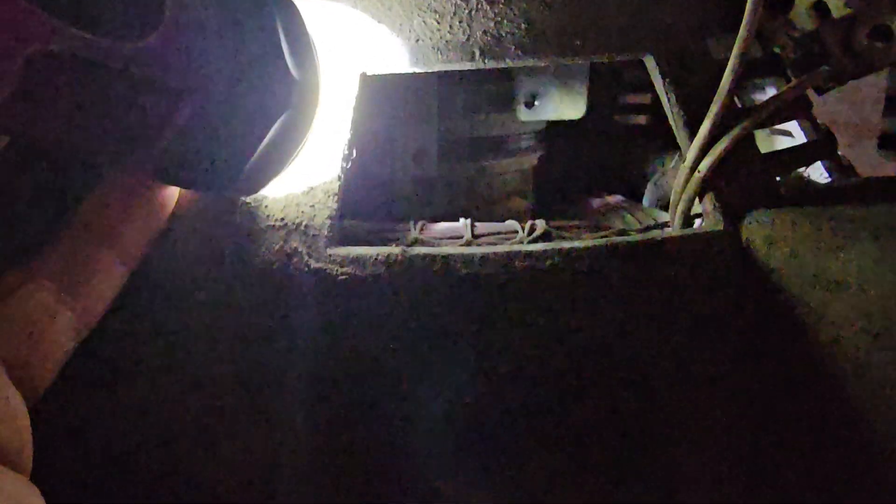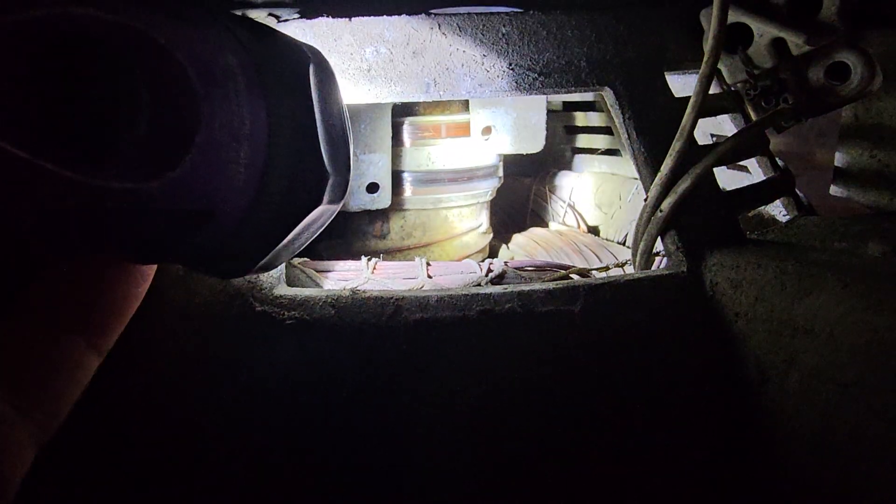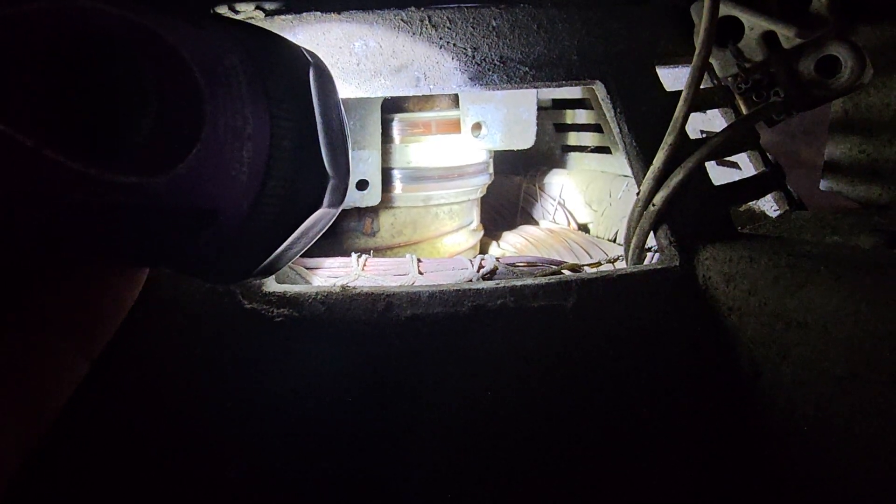See if I can do it this way a little bit better. There you go — the one on the left has a real good rust edge. That copper one is where I was cleaning it up, so it's going to take a little while. They make a thing called a slip stick by Flight Systems — it ain't bad. Basically just take some 2000 grit sandpaper or emery cloth, real light, crank it over and clean them up.